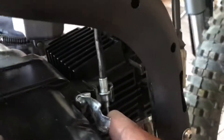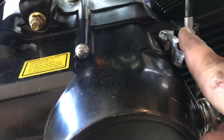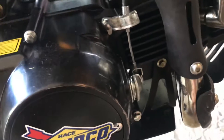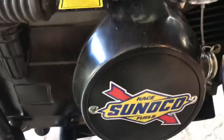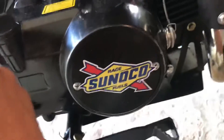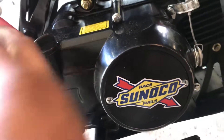I had to wrap the clutch cable around the bike in a weird way for it to actually be tight. You're gonna want to put the end of the cable in, then stretch it and fit it through. You want to make sure it's as tight as it can get, but not too tight — because if it's too tight, it's gonna be pulled too much and put it in neutral, and you won't be able to kick start your bike.